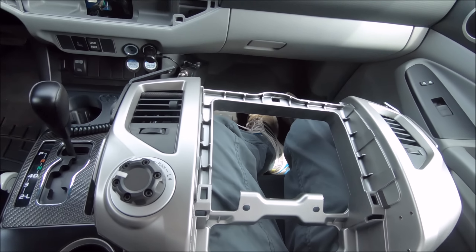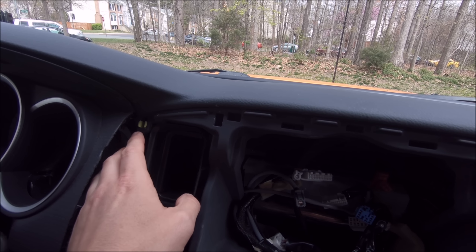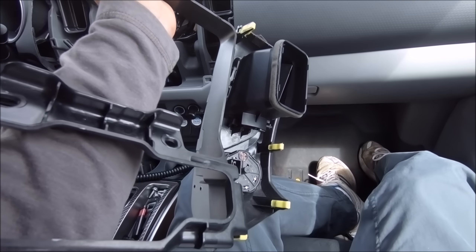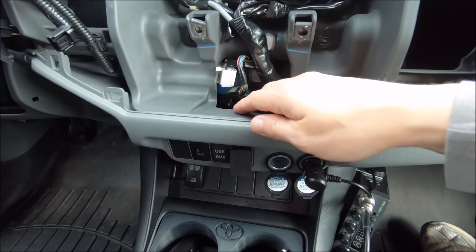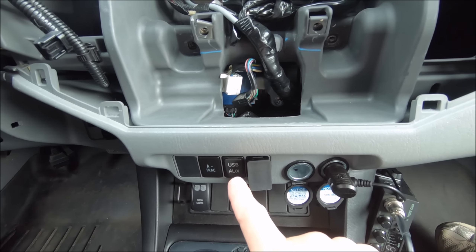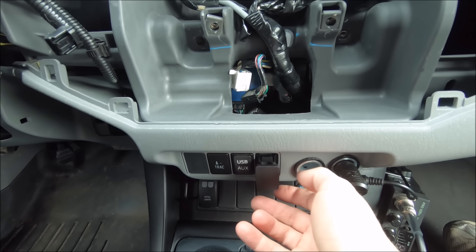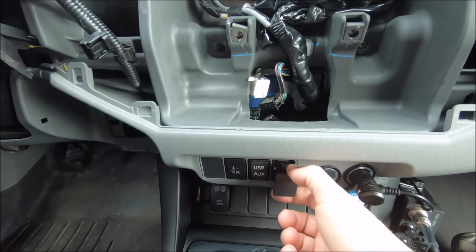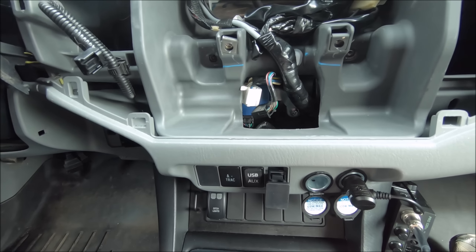And there is the opening left behind when you get this entire thing pulled out. I did leave one of the yellow tabs right there attached, so I'm going to take my needle nose pliers and carefully snag that. On the back of the console there are yellow tabs everywhere that help pop it back into place — just make sure they're all accounted for. With the center console removed, there is plenty of room to get your hand back here to pop some of these switch panels off. I've got a blank one on the right and the left, with the USB ports in the middle. They're both pre-wired, so if you want to install switches here, you can disconnect that and safely tuck away those wires if you want to run something like a switch for a light bar.